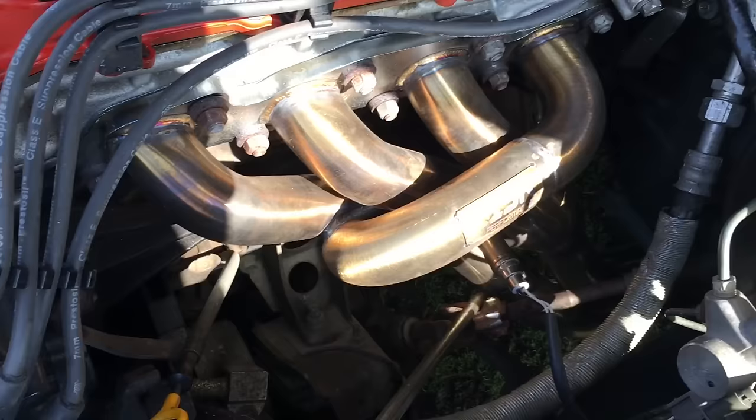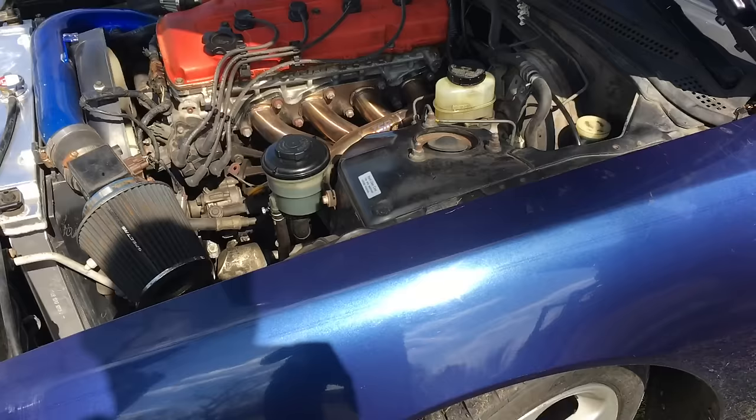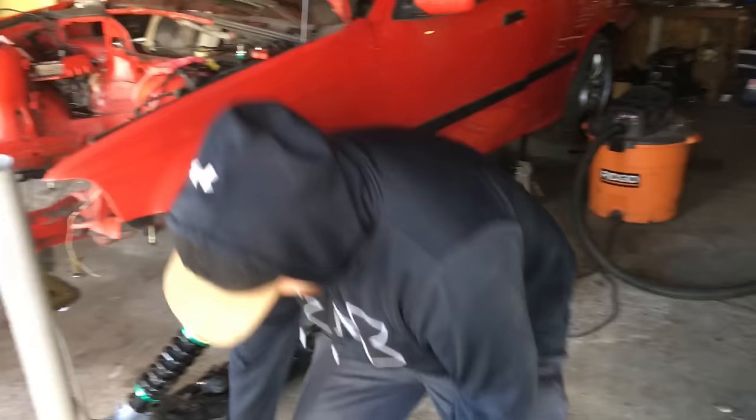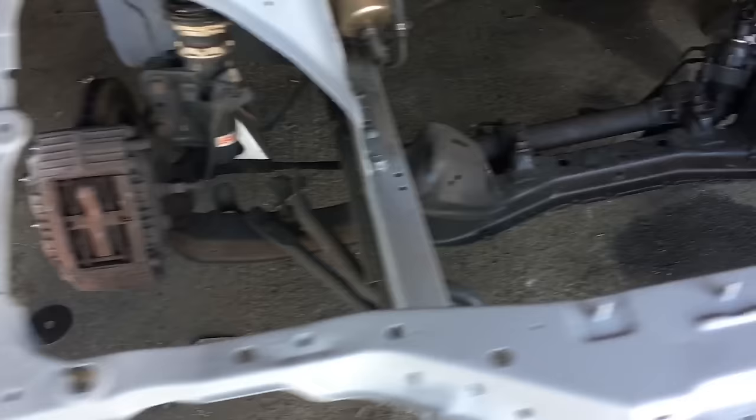So I tried to bend the header a little bit, and as you can see her motor mounts — look how much I can move the engine. We tested it by turning the steering wheel, and yeah, it still hits. We really need to bend that more. I think I've been on stiff springs and need to take those out. I'm actually about to drop the front subframe — just one of those things that needs to come out.